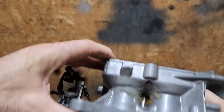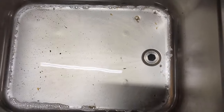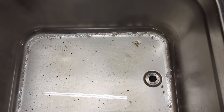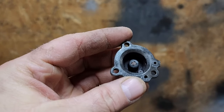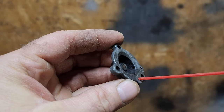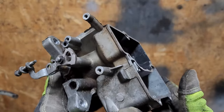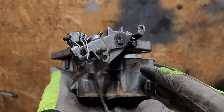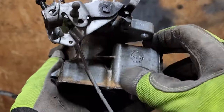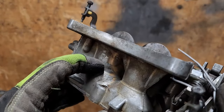Strangely, there's not much debris left in the ultrasonic cleaner - whatever it broke loose must have dissolved into really tiny particles that stayed in suspension. Let's see if I had any success with the motorcycle check valve. Nope, check valve is still plugged up tight. On to the lemon juice. Here's your first 20 minutes of the lemon juice. Not terribly impressive in my opinion. I did wire the throttle open. Some of it wipes off, but so far of the three I've done, I'm going to say Pine Sol is the best. Let's throw it in for another 20 minutes just to be fair.